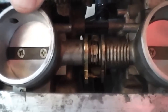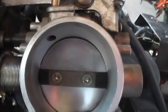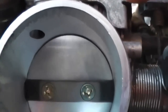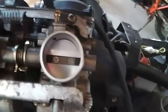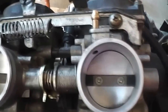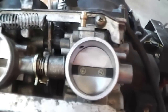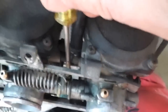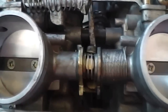Just give it a bit of a blip on the throttle — as you can see, number one carby's open a little bit, number two's closed, and I've got number three open as well, so I've got no influence on this centre carburetor at all. Now what I'm going to do is screw this screw for number one clockwise until this carburetor starts to influence the second carburetor.